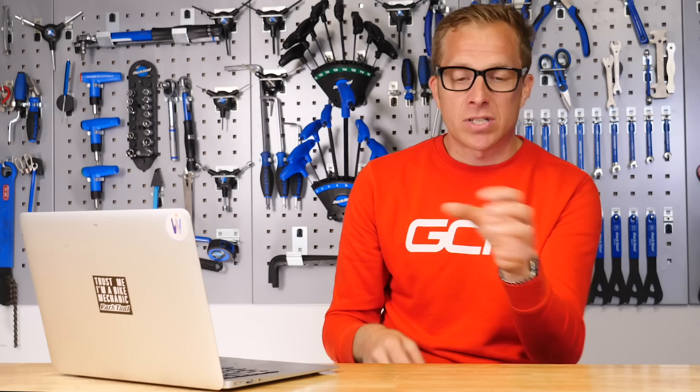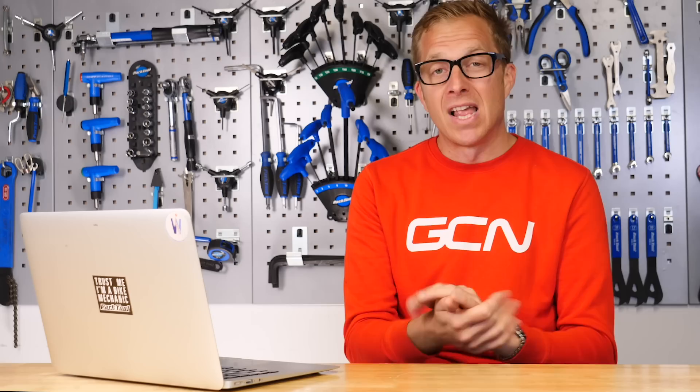If you haven't been able to do that, go to your local bike shop or frame builder and they can solve the problem. The best advice I can give is to not continue riding the bike with a loose rivet, because the bottle and cage will start to rattle, the rivet rattles, and I've seen this happen on both alloy and carbon frames — that hole becomes ovalized and oversized until you can't put a bottle cage bolt or rivet back in. Then you're having to patch it up with carbon in a real bodge of a repair. If it's already oversized and you don't want to risk ruining it further, stop riding it immediately.